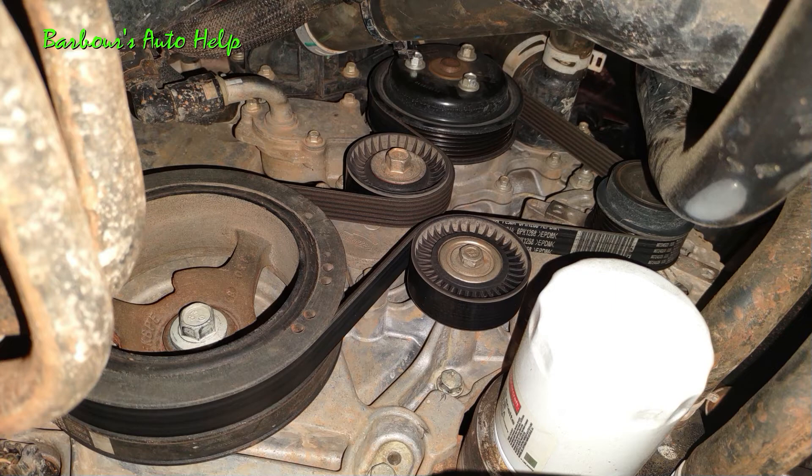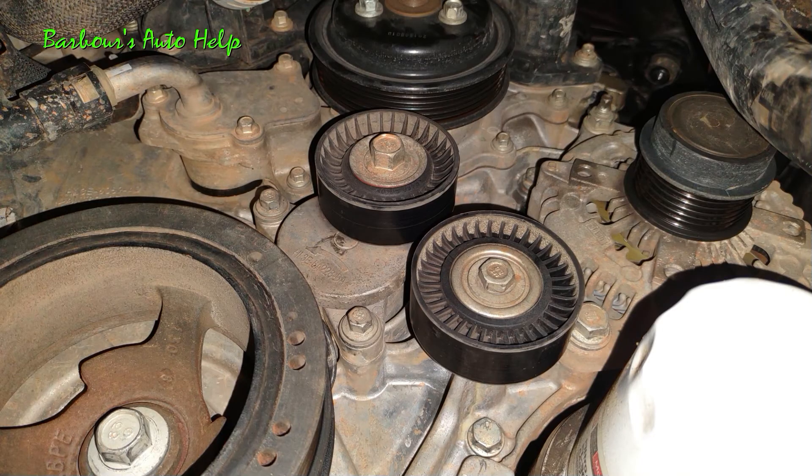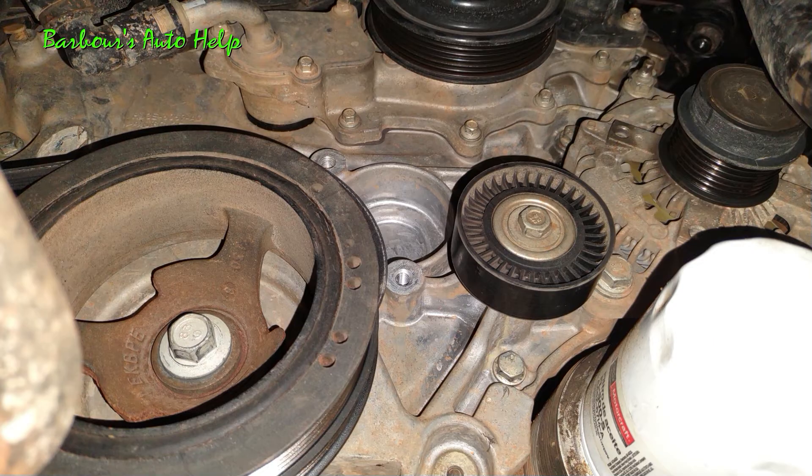If you don't overdo it, you should be fine. Now, once the serpentine belt is removed, I like to take it a step further. A lot of guys will disagree with me on this, but I like to remove the whole tensioner altogether. It's only held on by two bolts with 10 millimeter heads on them. So you loosen those up and remove the whole tensioner, and that gets it out of the way so you can operate more freely when removing and installing the AC belt.